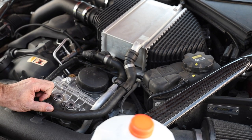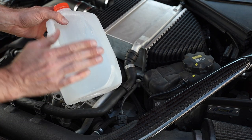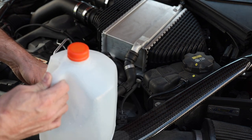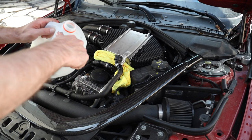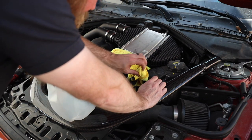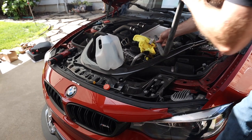We're going to do the Tommy El Garage special here — basically we take the inlet pipe, disconnect it, get right down on this tube, and literally fill up this little jug with the existing coolant in the system. We do that by giving this thing a little blow of air and it'll actually push all the fluid into the jug so we don't leak all over the place when we take this out. I cut my jug open a little. What Tommy did in his video was put his lips right on there, but my car is leaking out just a tad bit, so I'm going to find a hose the same size and do that blowing procedure.